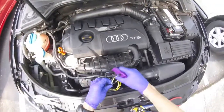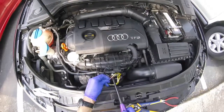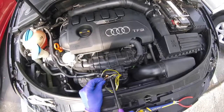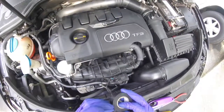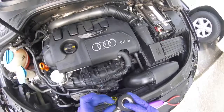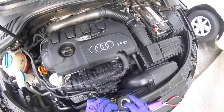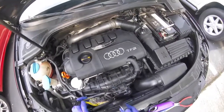This is not how you're supposed to do it per the Volkswagen manual, but I am outside at my apartment and can't pull a heat gun out with an extension cord. So I'm just going to go ahead and heat shrink these. Now that they're all shrink-wrapped, I'm going to wrap them in electrical tape. The TSB does say that per all OEM Volkswagen repairs, you use yellow tape to denote that an electrical repair has been done — but I don't want yellow in my engine bay, so I'm wrapping it in black so it blends in with the rest of the harness.